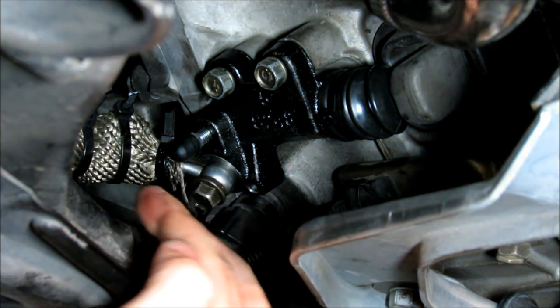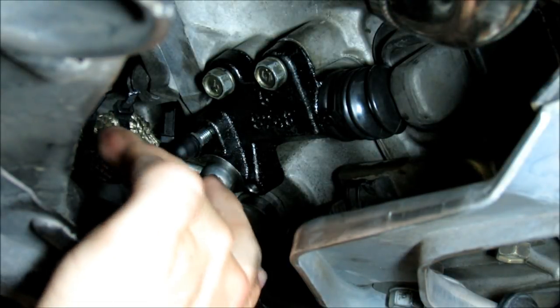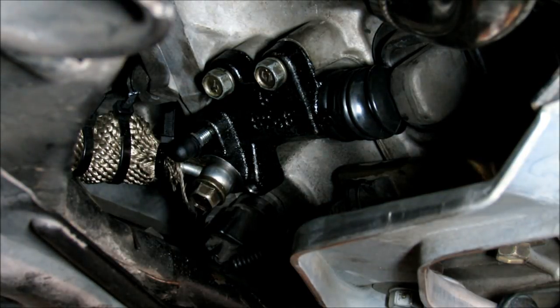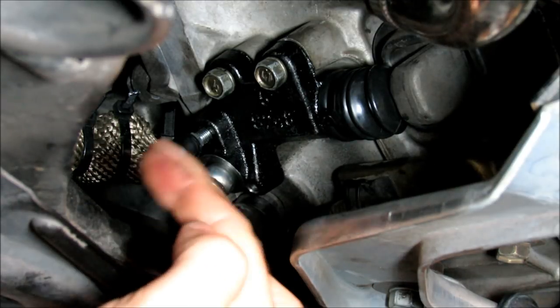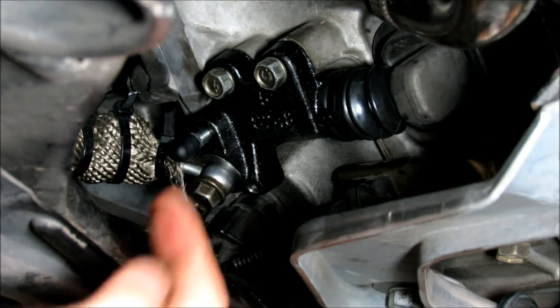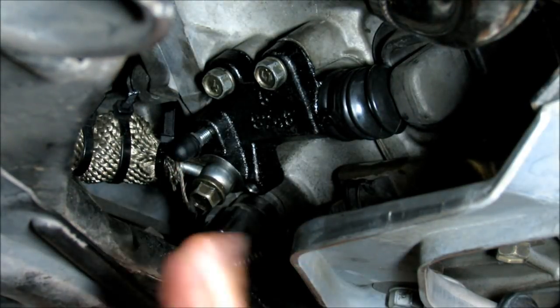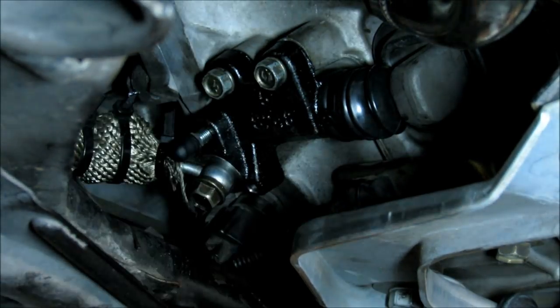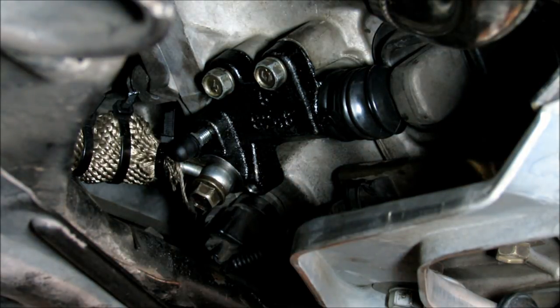And as you can see here, I put in a stainless steel line which runs up the side of this instead of the rubber hose. I did that for various reasons. I also took some heat tape and wrapped it around the stainless steel line, so any heat down here isn't baking the clutch fluid, which is brake fluid, coming down to the slave cylinder right here. Now that we have it installed, you're going to have another person help you depress the clutch pedal to pump it up and build pressure in the line. I'll go over the sequence of how you would do that next.